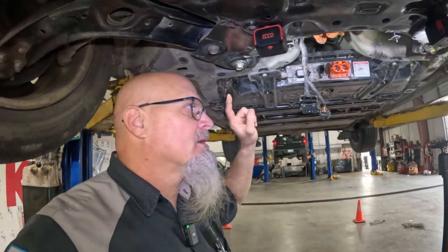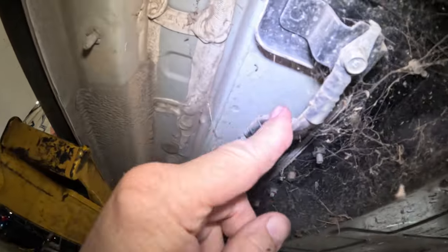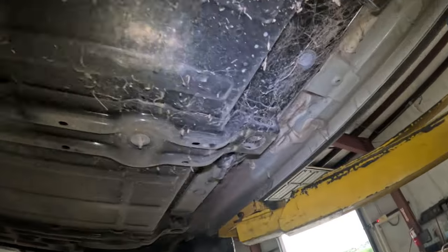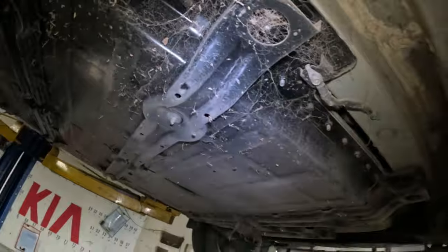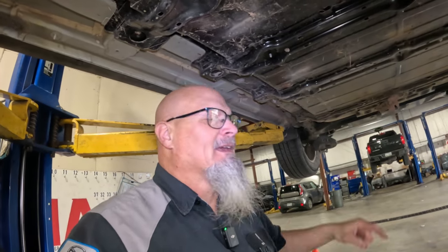and get that lift under here, lift it up onto it, disconnect those bolts, and then we got two ground straps. Here's one right here, and then there should be one right here too. And we'll get those off and we'll drop the whole thing down. We can move it out from underneath here, and that's when the fun begins. So let's get to that right now.